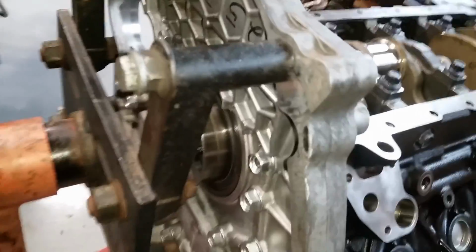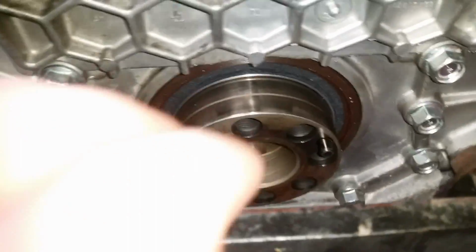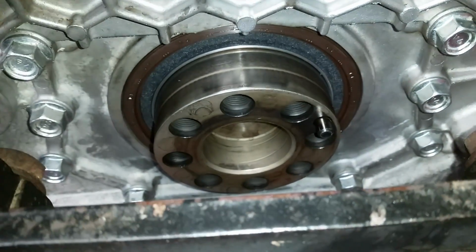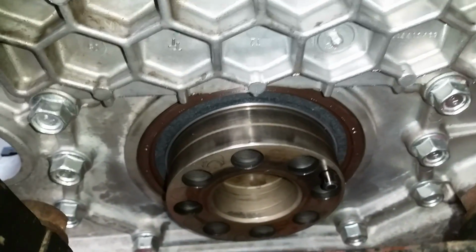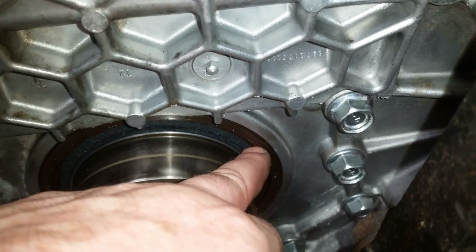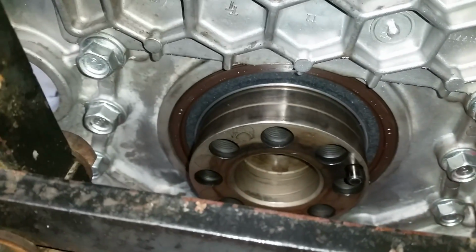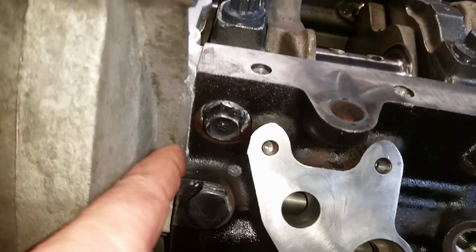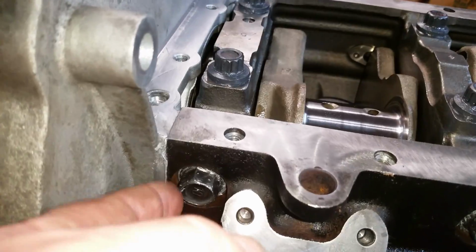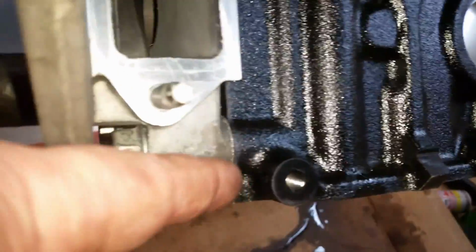Progress. Got the back cover on, got the seal on there. Made real special care that it's even. You know, measured even all the way around on there, so it won't wobble as it's turning. And I made sure that that inside is the same depth as the outside part. And just about the perfect amount of squish this time. It's just perfect. Perfect amount, even amounts coming out everywhere. I didn't need to seal, but I put some there. Just a little bit squirting out.